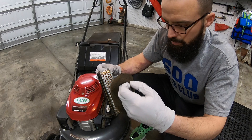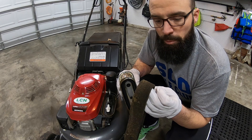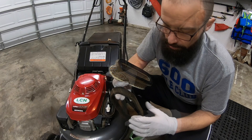I'll wipe down the rest of this air filter. What the manufacturer recommends is to wash this foam element in warm soapy water, then put oil on the foam element and squeeze out the excess oil, because that oil acts as something that catches the main debris — the debris sticks to the oil. So now I'm going to wash this foam element.